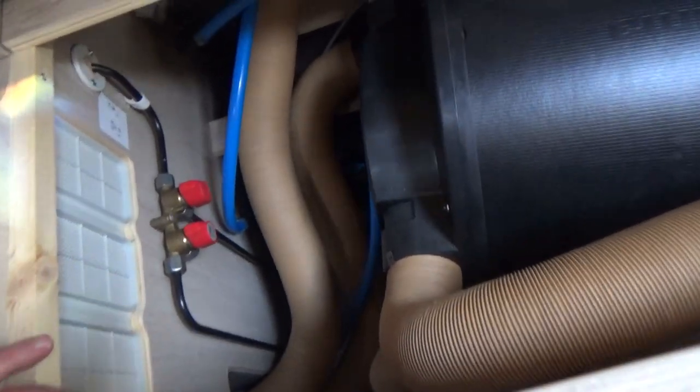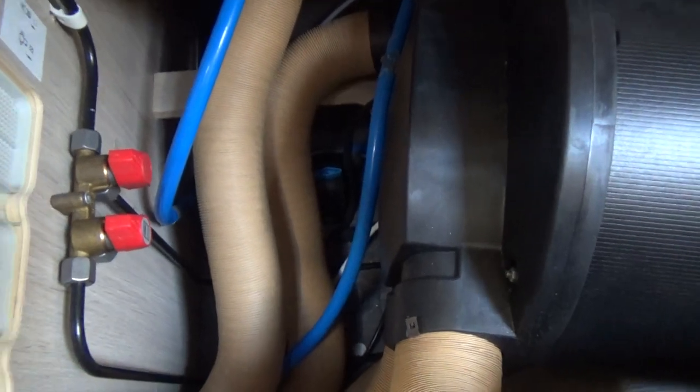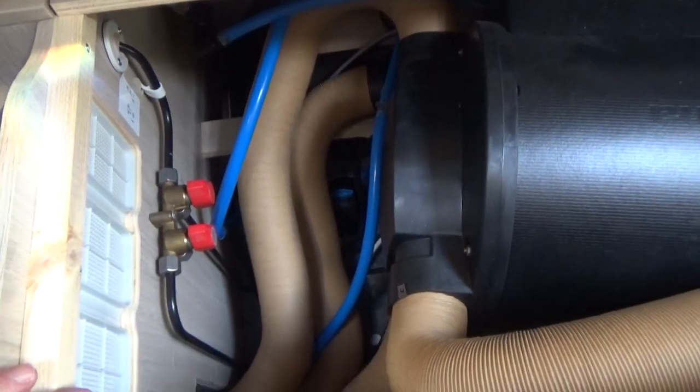What I'll do now is check that frost valve - it's warmed up a lot in here so it should be above three degrees. I'll make sure the button presses in and I can start priming up the water system. Let me dig down to the bottom - oh yes there's plenty of heat there. Yeah, the button's stayed in now. What I'll do now is turn the heating down and I'll show you how I prime the water system up.